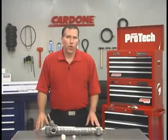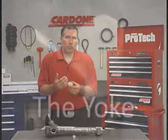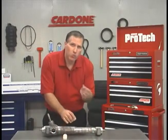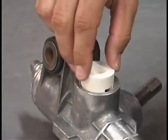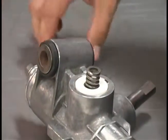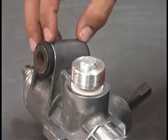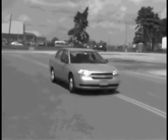Briefly, let's go over the parts and tech behind the issue. The yoke is the component that presses against the rack, which mates the rack teeth with the pinion teeth. It's backed by the spring and a threaded adjuster plug. The assembly is most often retained by a large lock nut. Changing the spring tension against the yoke is what sets the preload adjustment or lash between the pinion and the rack. Too much preload causes the steering to bind; not enough preload provides sloppy steering and, in extreme cases, teeth slippage.